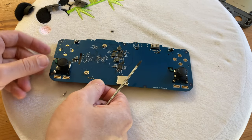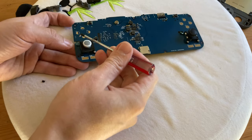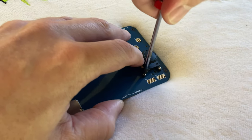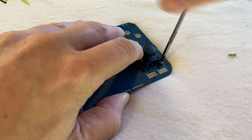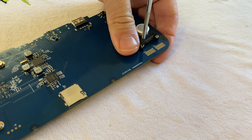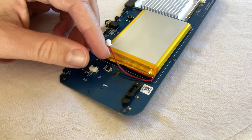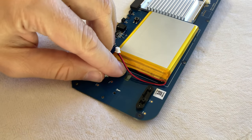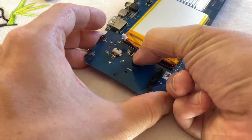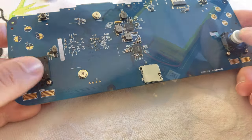We'll first remove the screws for the left side. Surprisingly, these Vita sticks are just made for this thing — to be honest, it's very effortless, just screw it in. And now for the right stick. If you're not careful, the black tab will fly off, but you can actually reset it using your fingers. Now to reinsert the ribbon cable for each stick. And it's looking better already.